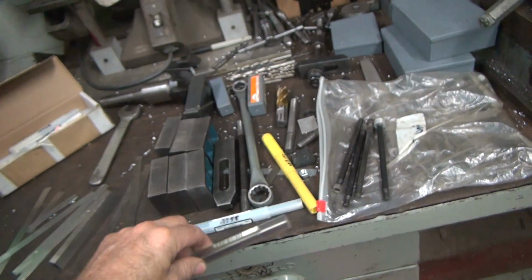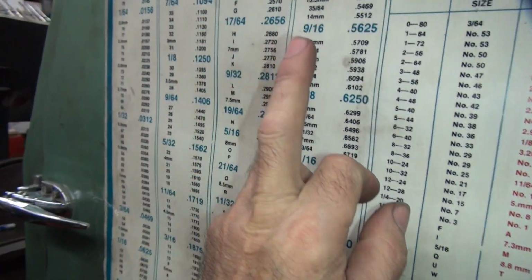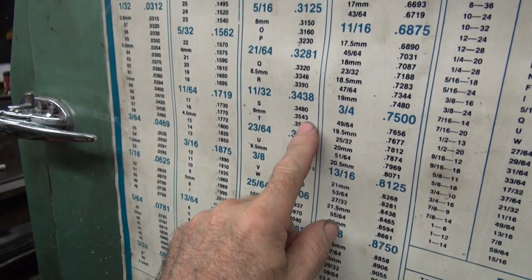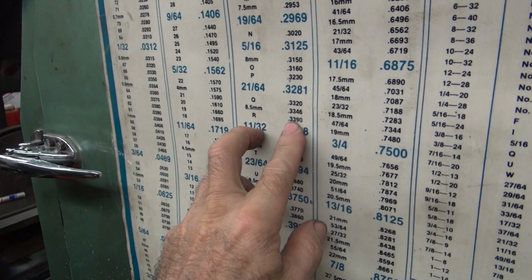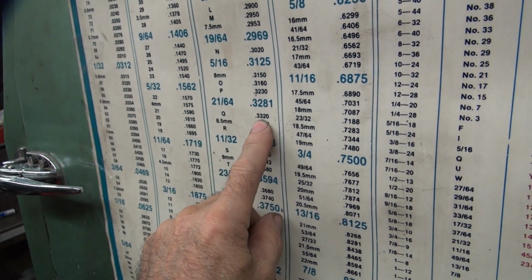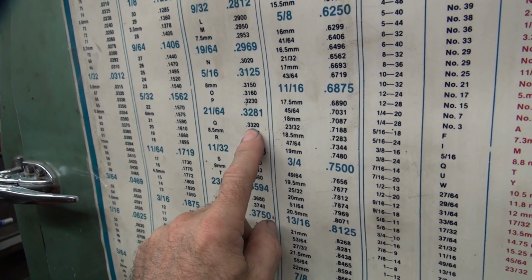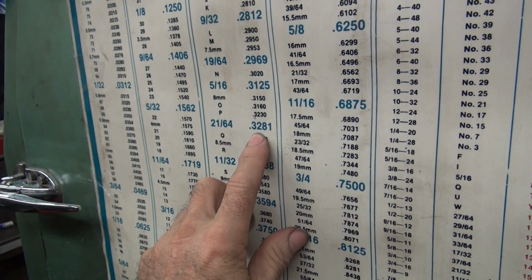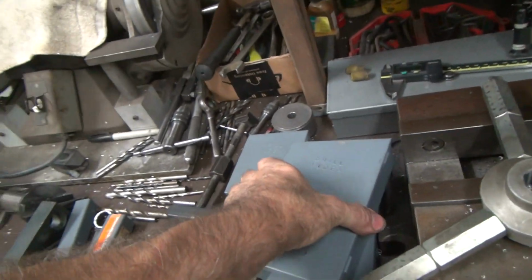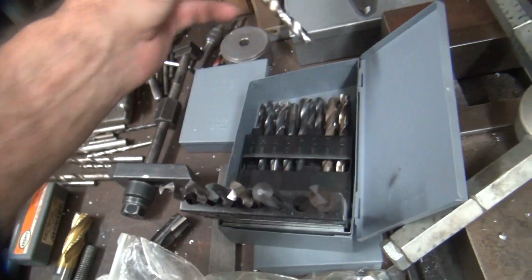these are reamers, so you have to drill a hole through first. So what's our closest size to 337? 339 is an R, too big. We don't do metric. So that leaves Q. 332. That'd be pretty damn close. And we also have 2164s, which is 328. So Q is the magic one. That one.